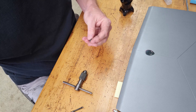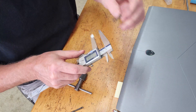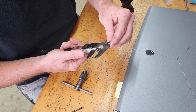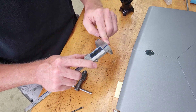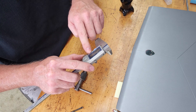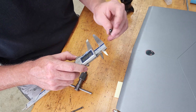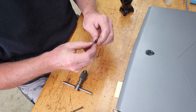Now all he needs to do is source some fresh titanium bolts. These guys measure 17.6 millimeters long. Whatever he ends up with, I'm sure a little longer would be okay — if you could get 18s or even 20s that would probably work. Let's make sure everything's clean here. Checking again: 17.75 millimeters. Thread is 5 millimeter, 0.8 pitch, and 17.75 millimeters long.